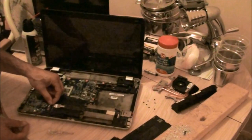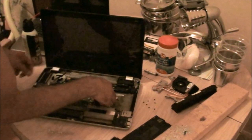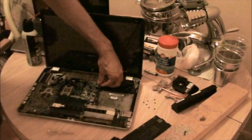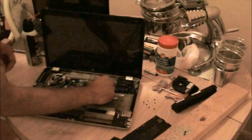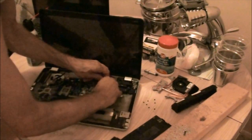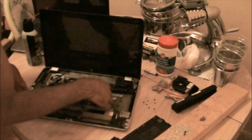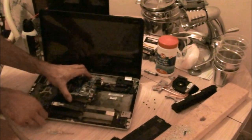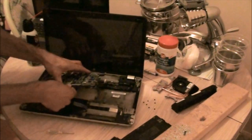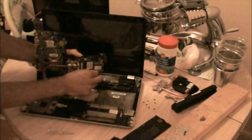There's another little tab you gotta flip up. There's a memory card reader. Over here you've got another speaker connector on top — just pull it away. Then this big white cable is the power. You should also take off the WiFi antennas off the WiFi card — not strictly necessary, but otherwise you've got to do it at this point. They just pop off.